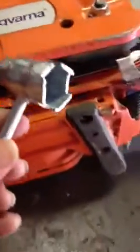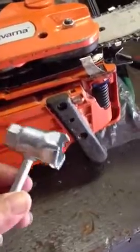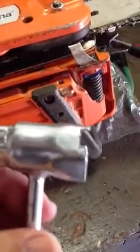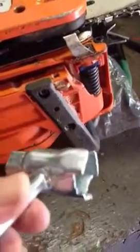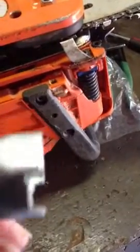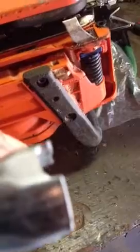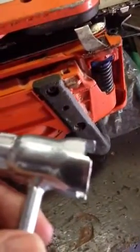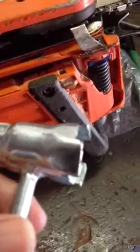So that's the way to do it, quick and easy. There are plenty of other videos that explain what the problem is and why you should not take it off without releasing the brake. But this is one way of solving the problem — just get an oscillating tool with a metal cutter and cut out some slots appropriately to fit over the inside of the spring release setup.